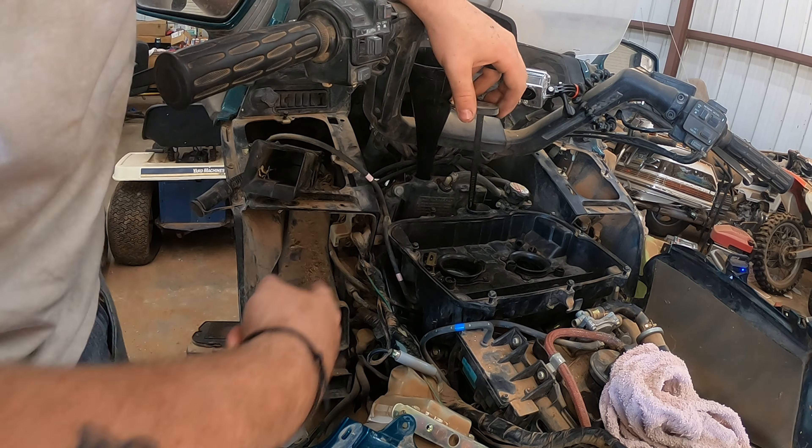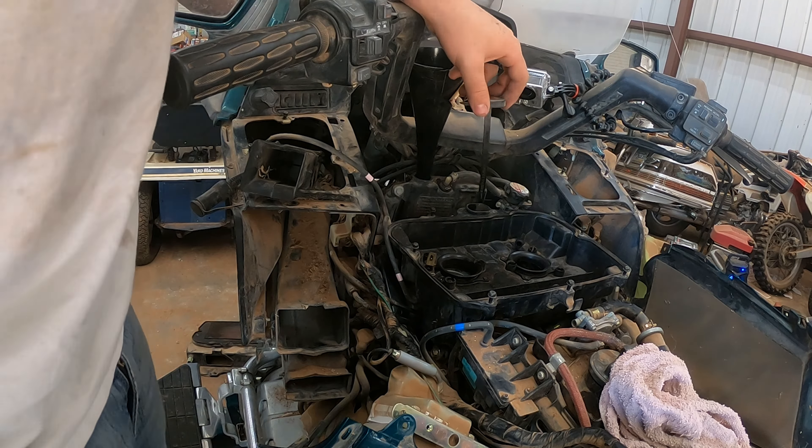The easiest way to seat these is, like I said, with the lithium grease. To get to the antifreeze lines in the back, these 45-degree pliers from Harbor Freight — I recommend maybe filing them down if you think the lines are old, because you do not want to puncture them and have to replace one. I have a pair of pliers I use just for this application with the teeth filed down so they won't puncture it. Apply lithium grease on the boots and then just some firm pressure, and that's the way you get them seated.